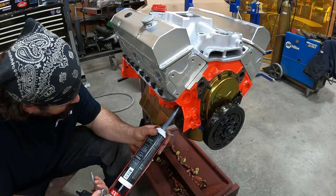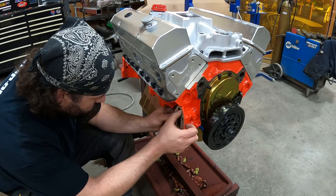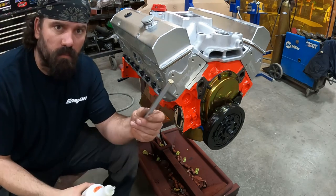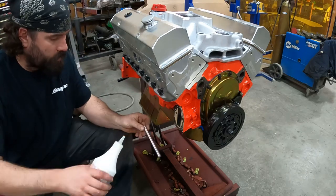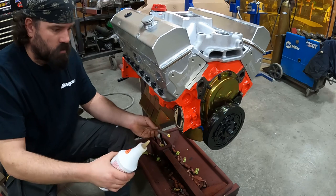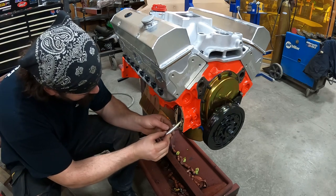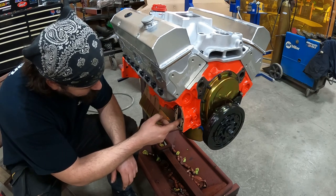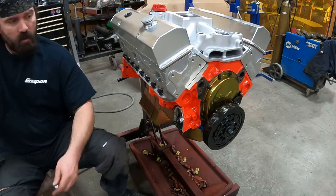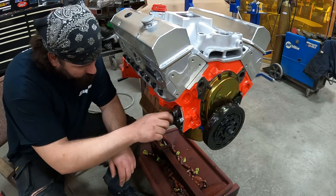Get a fuel pump push rod cover ready to go here. Using a push rod with a bronze tip on it, again for that roller cam. Put a little oil stabilizer on it. Barely snug these up, let that silicone dry for a couple hours before I tighten it down. I can trim off any excess that comes out around it after it dries.